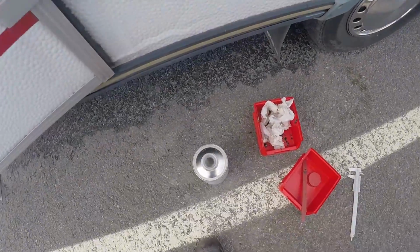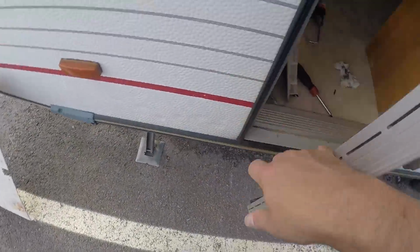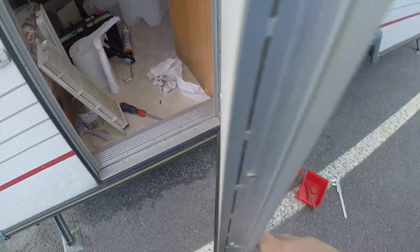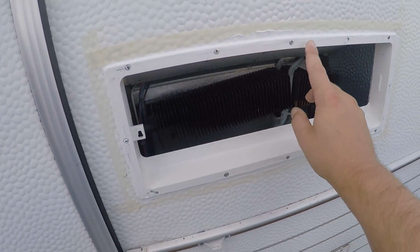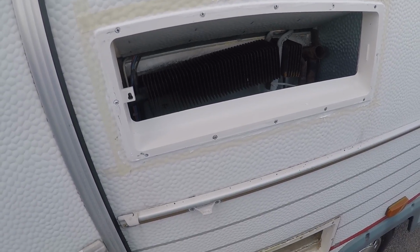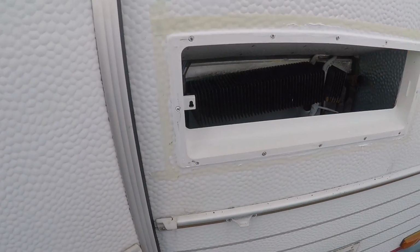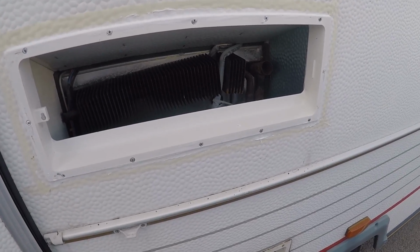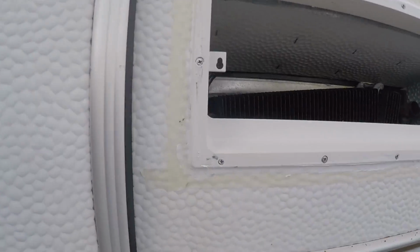And if you are using your fingers, have the acetone ready and paper, so you don't touch anything with the glued fingers. Then you need to wash your hands with the acetone. That is the downside. But I let it dry for a little bit, like half an hour or something. Then I'm just wiping these with the acetone, a little bit of excess. And I also wait something like 10 minutes, then I remove the tapes. And you want to clean all the black one, which is basically the old glue. But right now you can see it's basically sealed all the way.